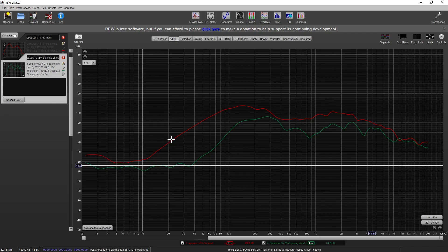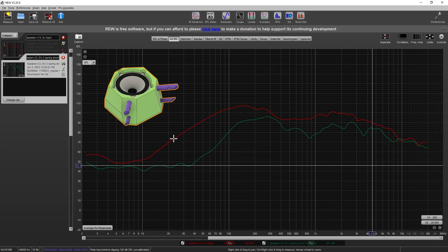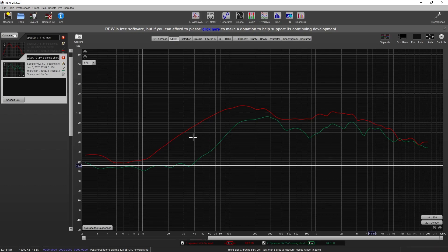We're in REW here. We can see the version 13 speaker versus the version 12 speaker — red is version 13, green is version 12. They both have the same input of 0.5 volts read at the amplifier, running the same pink noise simulation in REW. This is a pretty apples-to-apples comparison. The new speaker outperforms it in almost every single spot except a tiny area around 9000 hertz. It feels like a much flatter response and is definitely a much louder response, and I believe that's largely due to the underhung design.